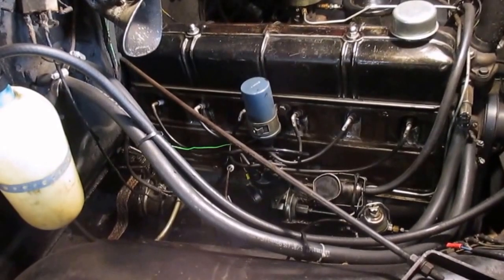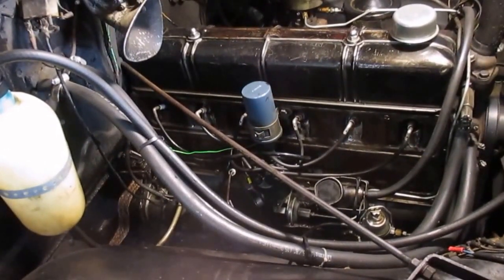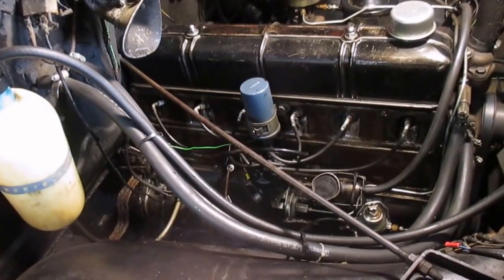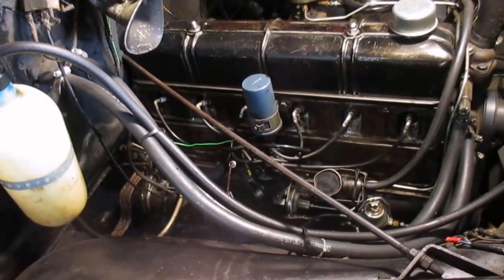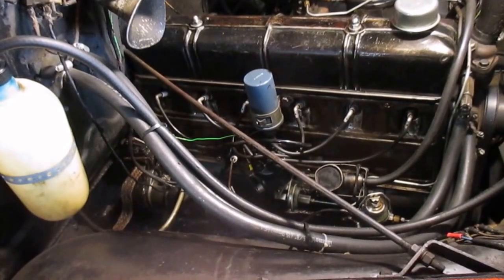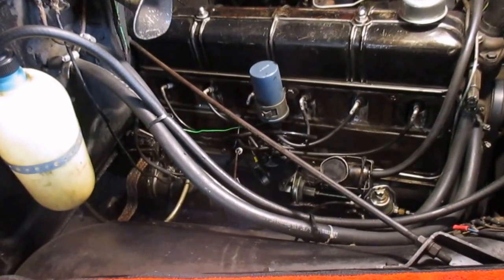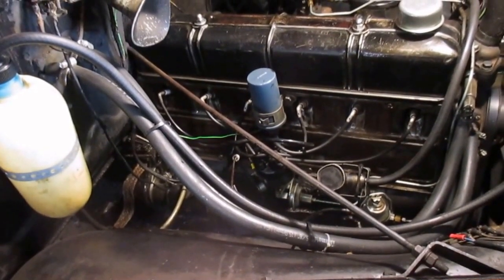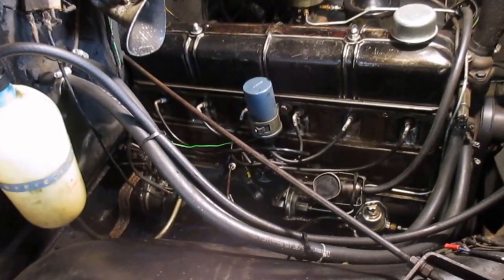First time is when I removed and replaced the head to get the engine running. It's about 3 years ago. Second time was last year when I discovered that the oil line to the rocker shafts had come apart there behind the oil gallery pan from where it had inadvertently rubbed against the push rods, and I wasn't getting any oil to the rocker arm, so I had to replace that line.